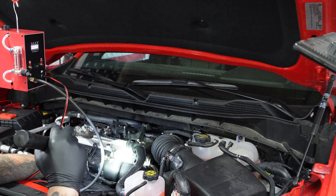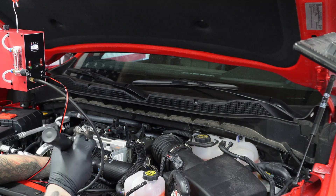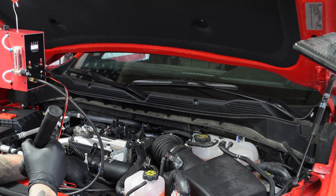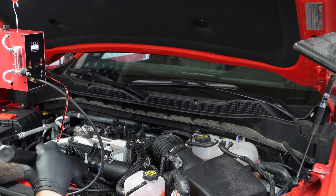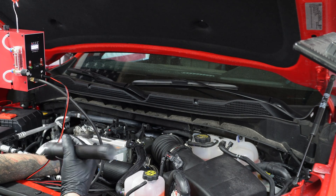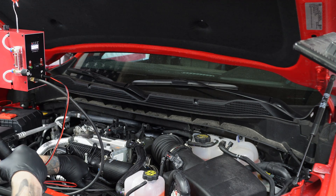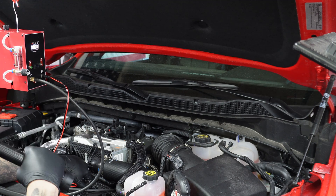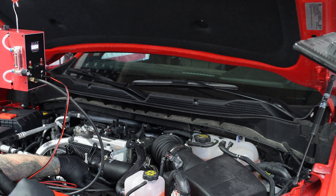You're probably wondering: can you do this on the exhaust system as well? Yes — you just need to block the tailpipe, pick one of the sensors up here to inject smoke from this side, and the back side being clogged means smoke will fill the exhaust system. One thing to note: smoke will dissipate when it goes through the DPF. So if you're testing anything on this side, start your smoke test here; if you don't see anything, do the smoke from the back side and block off the front.